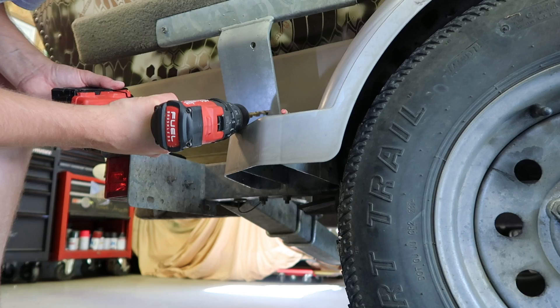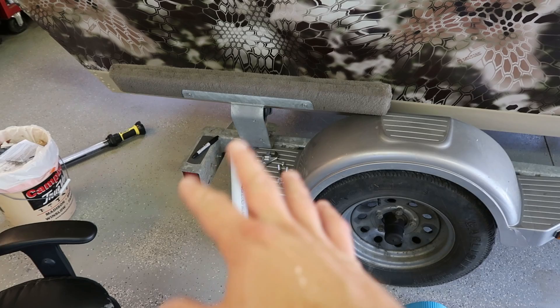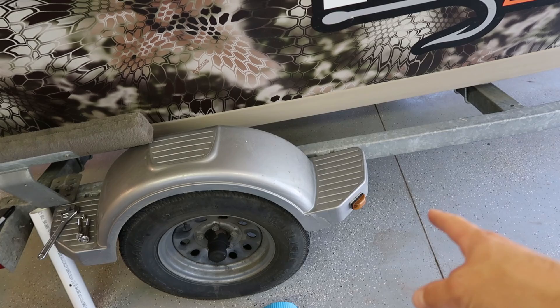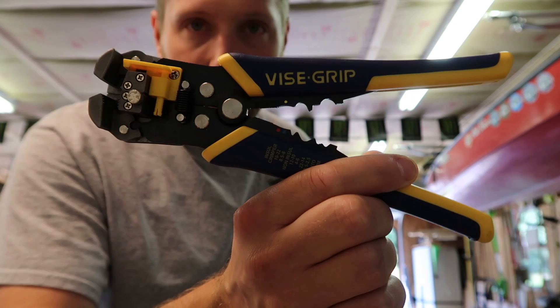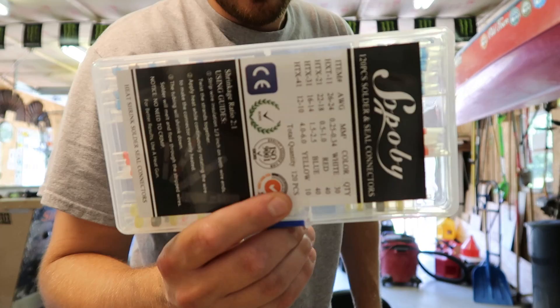Before I put all of this together I'm gonna run the wiring. I'm going to wire up the light on top and tie into this marker light right here, running it along the frame. I don't want to mess with the tail light in case it ever gets damaged — I want my tail lights to at least work. The marker bulbs I don't care as much about. I'll link these pliers in the description because they're great — they cut and strip the wire so you don't end up gouging into it.